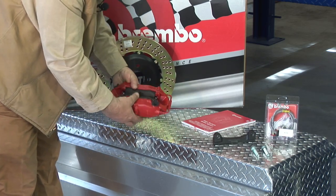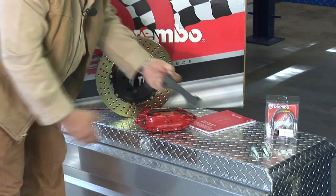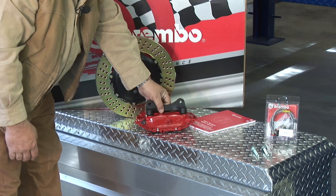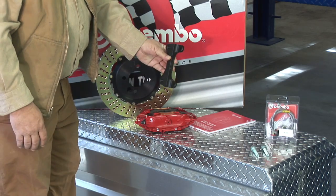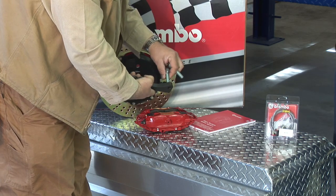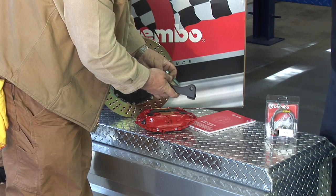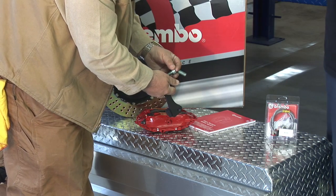That's a pretty nice looking unit. These couple of bolt holes here — I guess this is our adapter? That's the adapter, made for the 2007-plus Mini Cooper. It allows us to fit this without making any modifications to the steering knuckle, going right onto our two existing mounting holes. We've got two metric bolts here — M12 by 1.5 — some pretty serious bolts going right through the body into the steering knuckle.